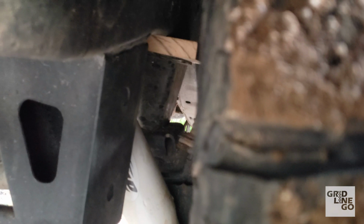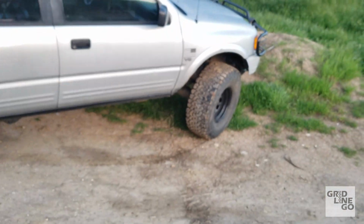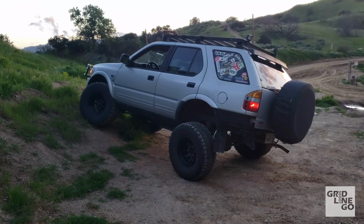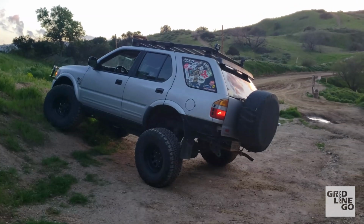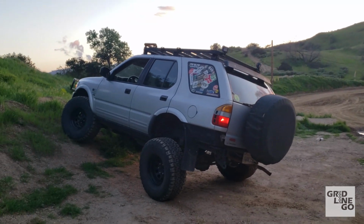I am on them, so I can actually see right there. I am just on it. So that's 3/4 of an inch on bump stop. So I'm thinking I'd do 1 inch. That's exactly what I was looking for. I wanted some tuck still, and I didn't want complete obstruction. So I think I'm gonna go with 1 inch bump stop extension, and that should fix that. And I think I'm done with my R&D. So now I gotta find something that'll fit that perfectly.